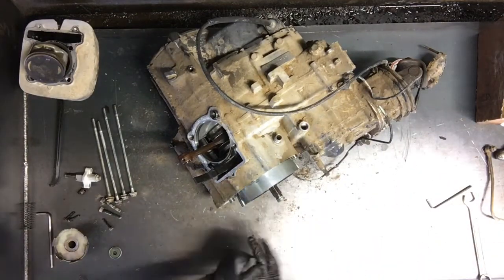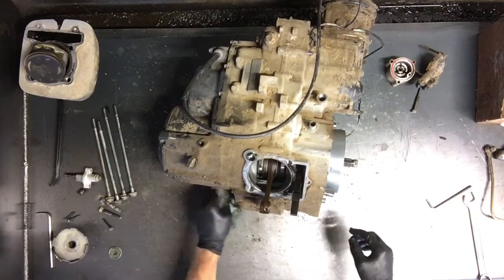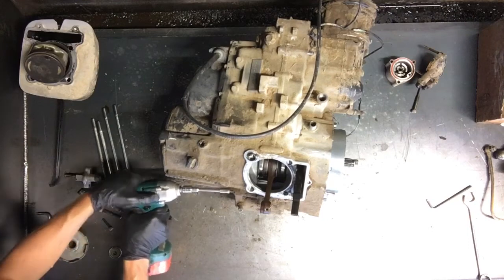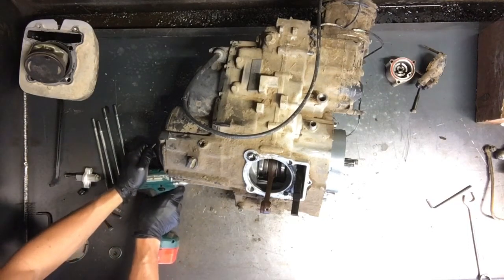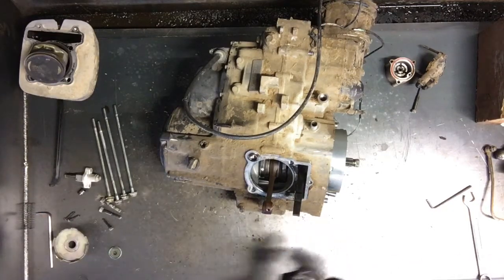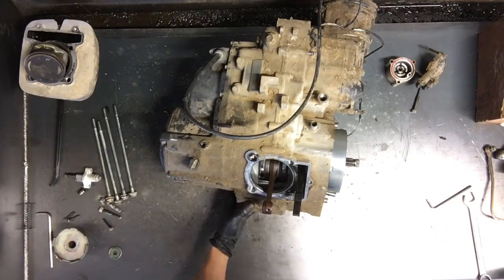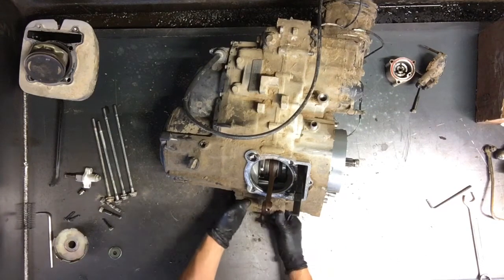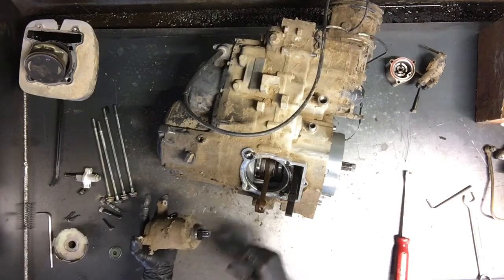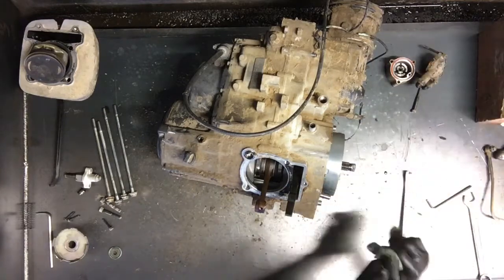You've got your starter on the front here. That will pull off with 8mm bolts — just two of these and they sit on the front of the motor. Got a 10mm wire here. And this will just shake right off here. There's the seal there, the O-ring. Make sure that starter turns freely, and then hook power up to it to make sure that starter is good. Make sure there's no abnormal noise and make sure it doesn't catch.